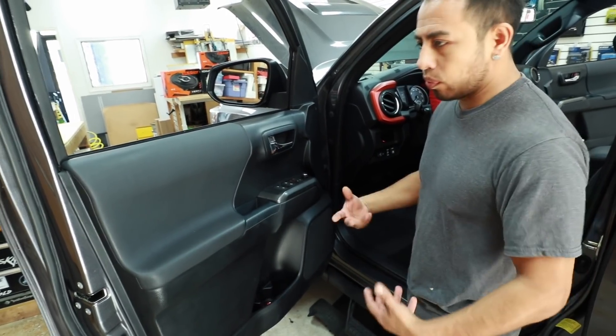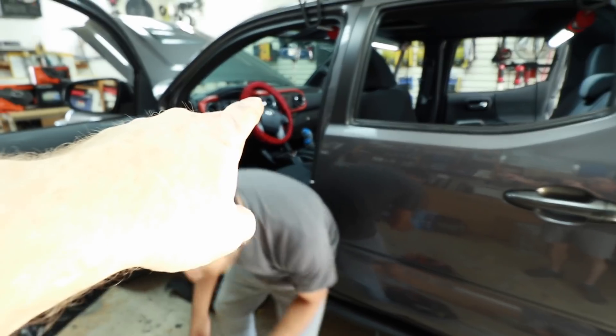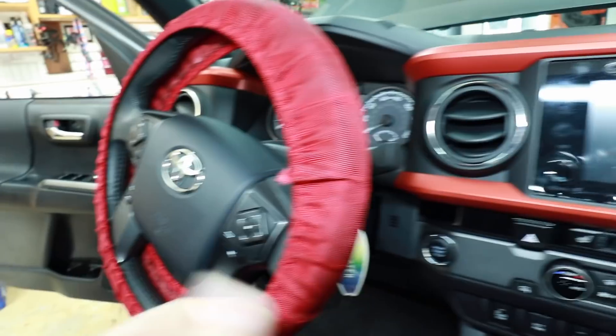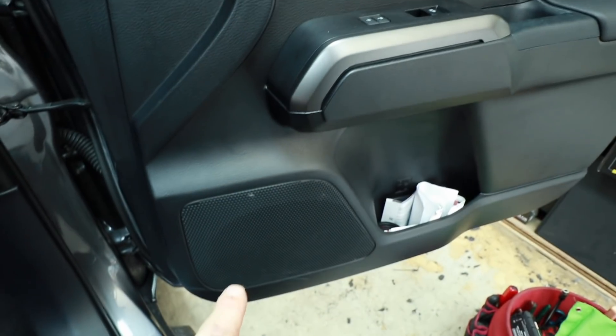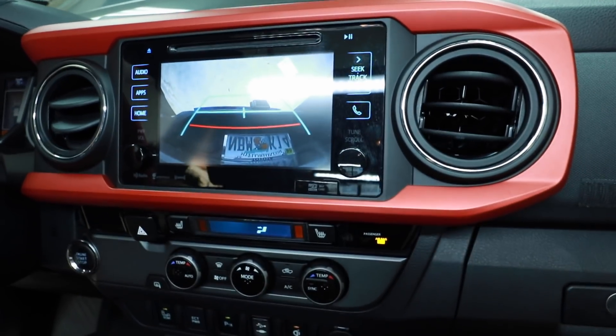While Fernando gets the door panel off, let's get the radio out of the dash. Since we're in the car, let's take a closer look at what it has from the factory: steering wheel controls, factory USB, factory navigation with a touchscreen, speakers up in the dash, six-by-nines down in the door, a six-and-a-half in the rear door, and a factory backup camera. We want to retain all those factory features while filling the holes where the existing speakers are, since we're doing super-loud tweeters in the dash and coaxials in the door.